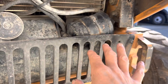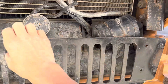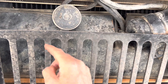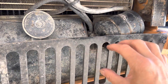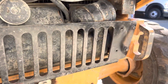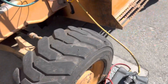This is why you do not install receiver dryers that are not designed to be laying down. Jaguar and a few vehicle manufacturers have specially constructed receiver dryers that lay down horizontally — they have an inlet on one side and outlet on the other, and the way they're designed inside, they pick up the liquid refrigerant from the bottom side. They have to be positioned in a certain direction and were manufactured to lay down horizontally. This was not manufactured to lay horizontally — it should be standing straight up vertically. But you can actually see how low the refrigerant level is; it's below the pickup tube when performing the recovery and dropping the pressure.